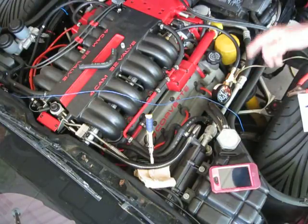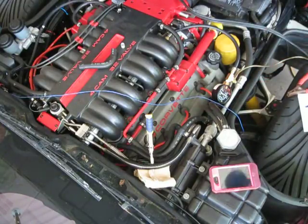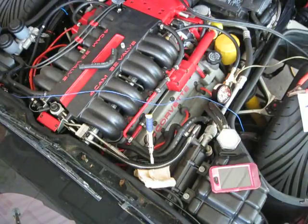And you can see after about a minute and a half, I'm under 20 psi, so I've got a leak somewhere. Let's cut this off to keep the video short and the upload time short. I'm going to keep doing videos and photographs of the install process of the new injectors, and I will have in the description of this video a link to the Corvette Guru forum boards where I'm going to do the photo documented process of the injector installation. Not something I'm really looking forward to, but it has to be done.